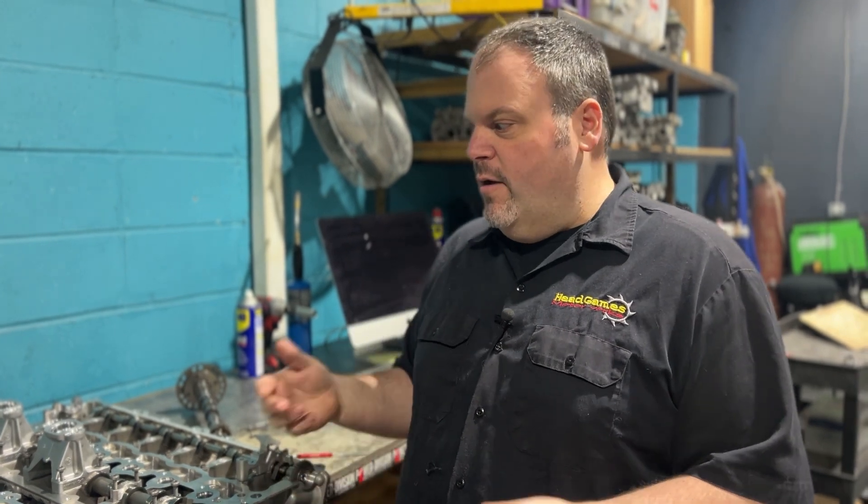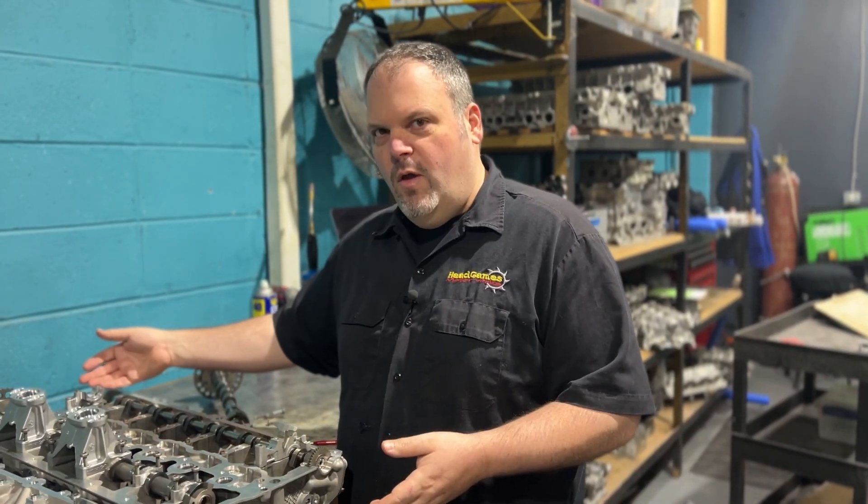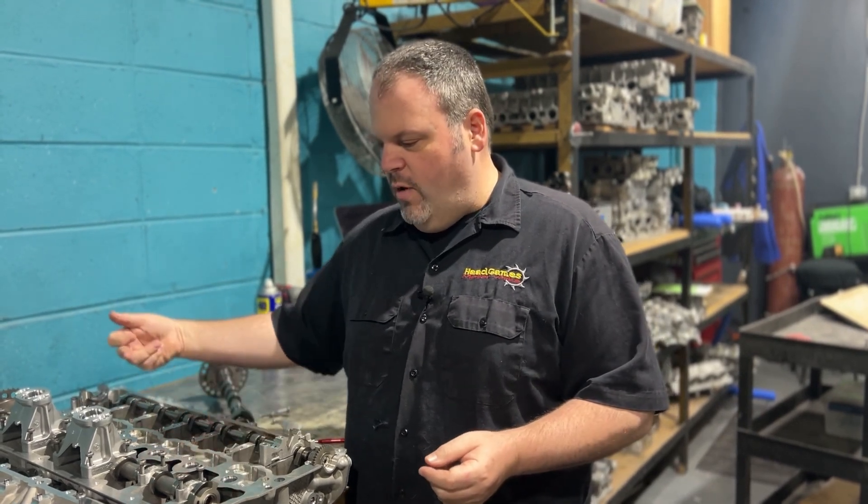They're not going to give it to you piece by piece. I know there's a lot of guys thinking, if I could just adapt the cam cap, then we'd be good. But there is actually no way of adapting it very easily — you would pretty much have to go to another head. And if you crack one and think you're just going to get one from the junkyard and stick it on your head and it'll work — that actually doesn't work. Because during manufacturing, they put all the cam caps on and then they bore it, they machine it in one fashion. So these are all centered. If you have a different cylinder head, it's not going to be the same bore size, or at the same spacing — it won't be aligned.